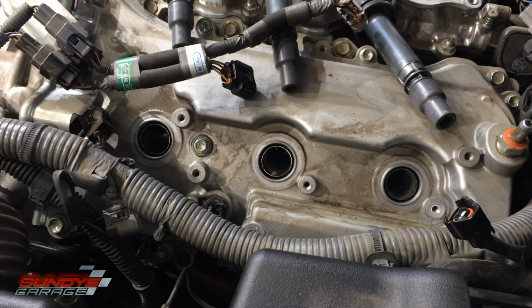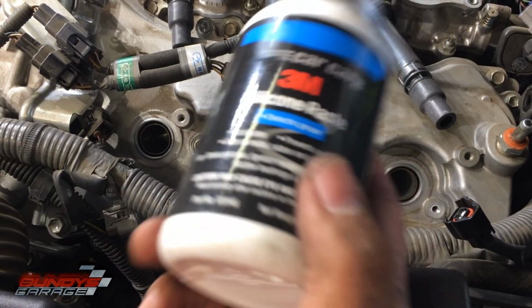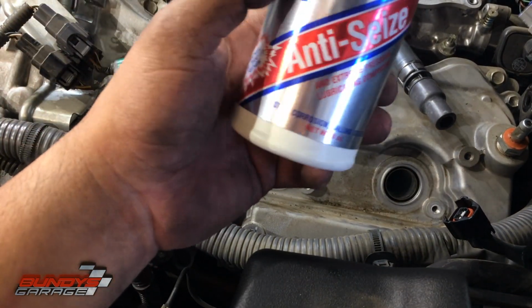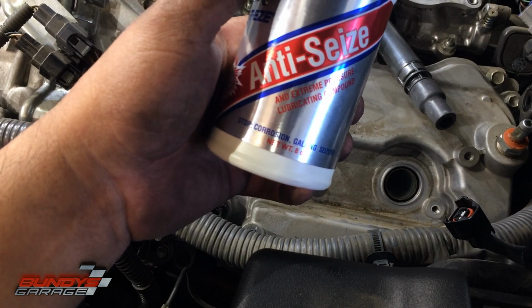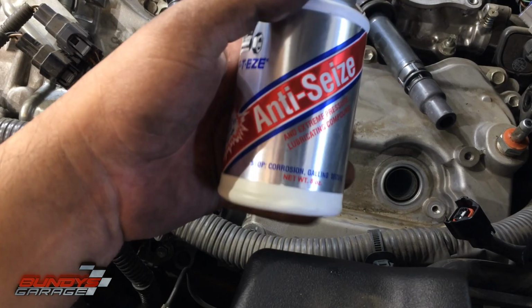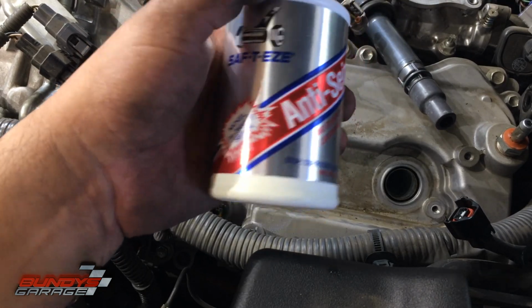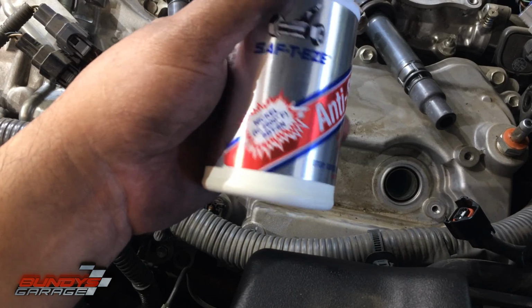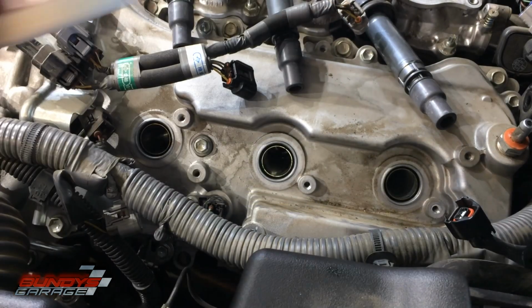Okay, so the two things I'll be using: dielectric silicone paste, which I'm going to put into the coil packs, and a nickel-based anti-seize. This really helps with different metals, be that iridium or platinum, going into an aluminum head or a steel head. Just found this stuff works awesome. You could use a copper-based one, but it just makes more sense to use nickel, which is more conducive to different metals. Links in the description will be down there for both of these.